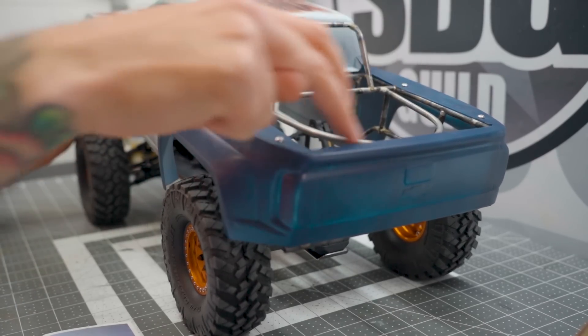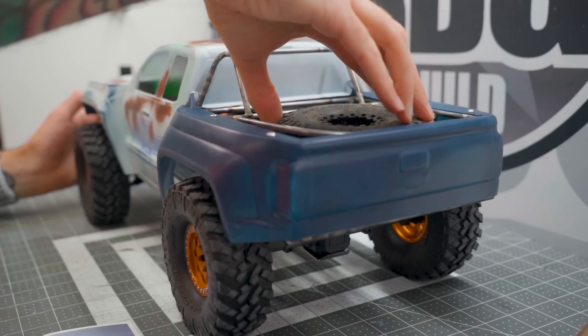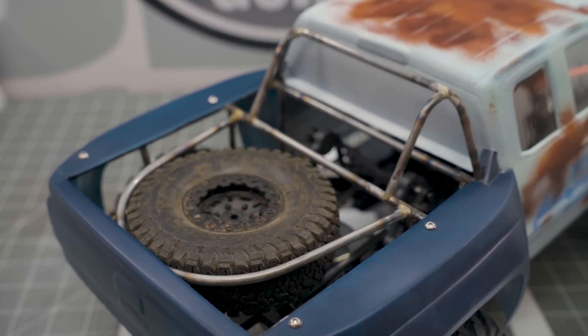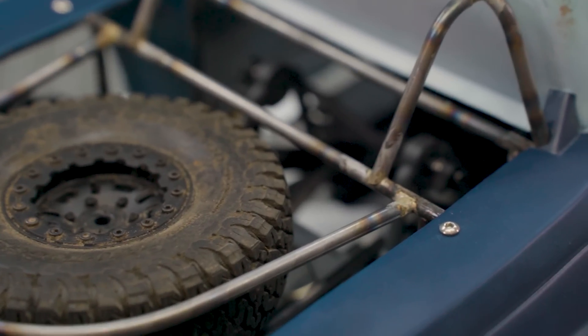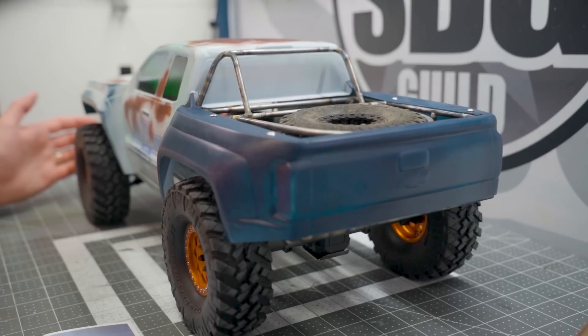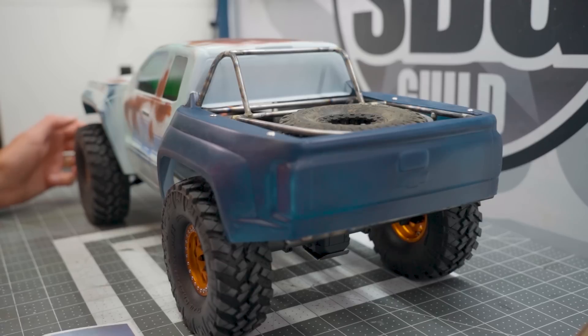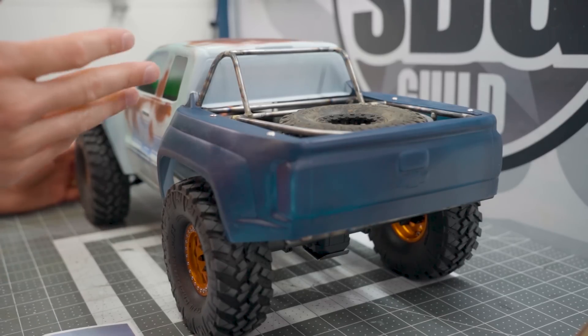Maybe they should be BFGs. For this large radius curve in the back of the cage, I designed that to fit a spare tire that'll sit in there nice and flat. To get a nice big round curve like that in metal can be challenging. Josh gave me a great tip — use a big metal water bottle, or in my case a coffee mug, wrap some tape around it, throw your tube into the vise, and just bend it around that round object. It gives you exactly the curve you need. For the back of this cage there will be accessories — a fuel cell and probably some sort of radiator, which I'll make in Fusion 360 and add later on.